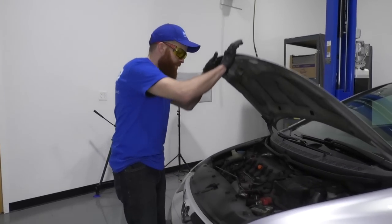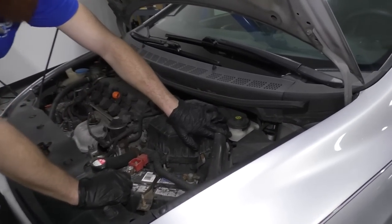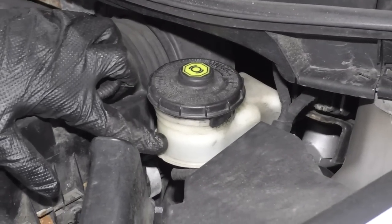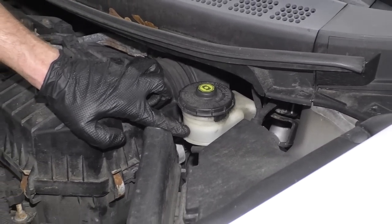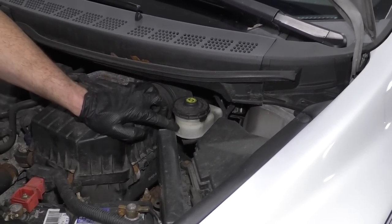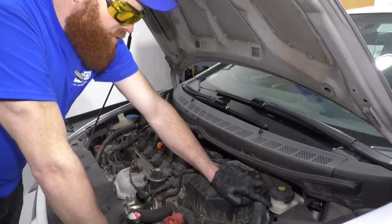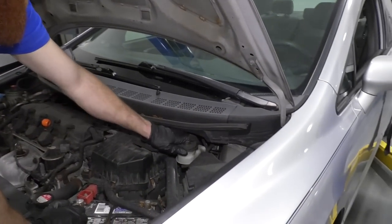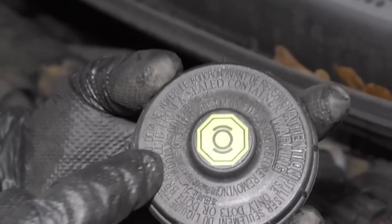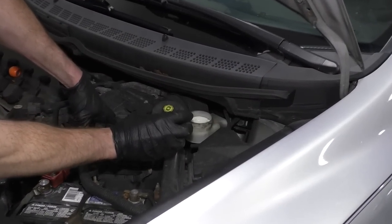The first thing we're going to want to do is pop the hood, make sure it's securely supported. Next we're going to check the master cylinder, which is right here — this is the part that has your brake fluid in it. We're checking it to make sure it has plenty of fluid, because when we disconnect any brake line, you're going to have fluid loss. If this fluid goes low or even empty, it could cause air inside your braking system, make its way into the ABS unit. You could get an ABS light or worse, lack of braking. Also, check the brake fluid cap — it reads DOT 3 and DOT 4, so make sure you have DOT 3 or DOT 4 fluid available. Always make sure your brake fluid cap is secure.